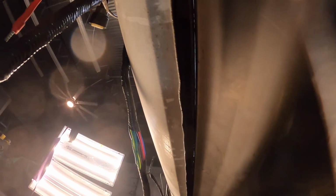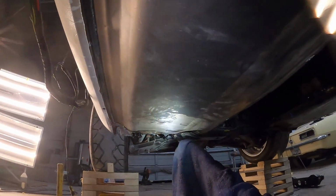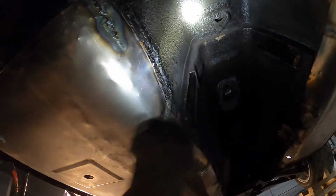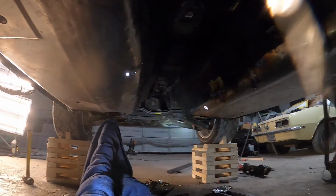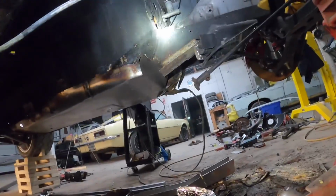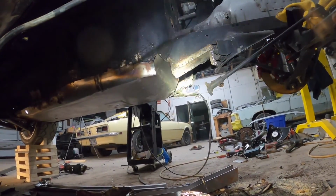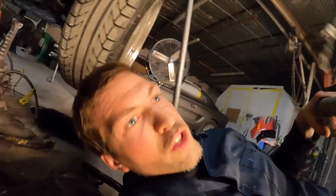If we look down here, I can take that clamp out, but it all looks really nice all the way down. Our gap's really good. All across the back it looks really good. And then all up in the tunnel, same thing. I'll come and I'll actually beat all of this over to the tunnel and then weld it in all the way down. Same on that side, I still gotta weld it all in. But as you guys know, I have to still build everything for right up in that area, right where the flashlight's at. So I have not welded the front of that floor in.